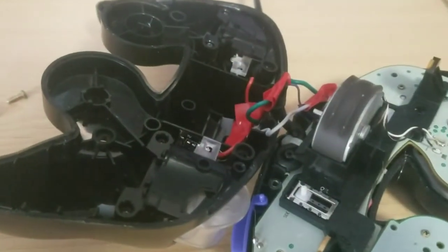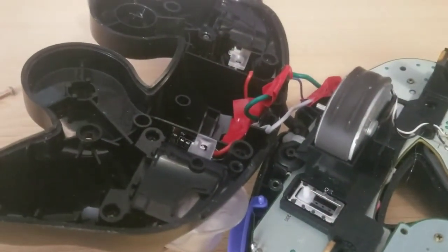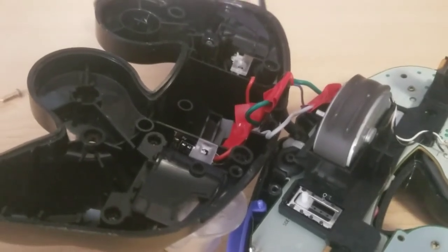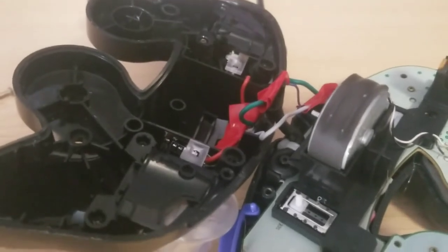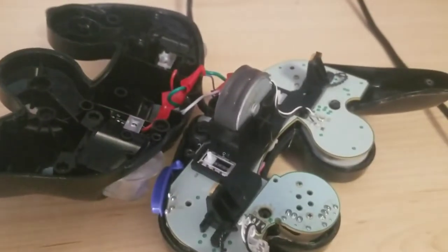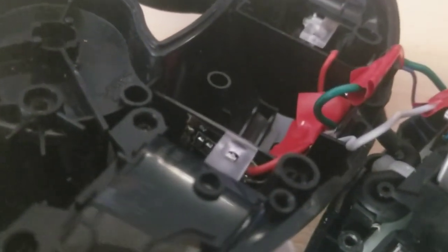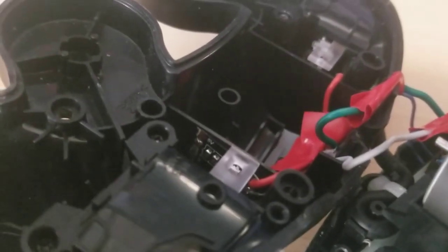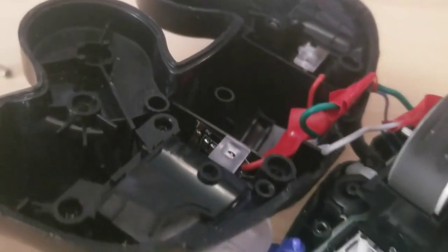With these LED strips, I used regular 5-volt LED strips, not the addressable kind. With the addressable kind you'd have to have a microcontroller in here, which would make it a lot harder to fit in a controller. All the red, green, and blue grounds are tied together — that's how I mixed the colors.